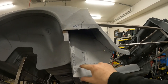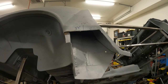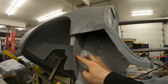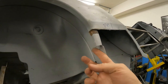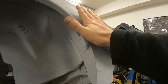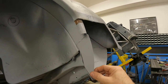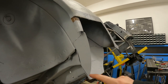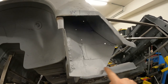We put in new pieces, kind of like a puzzle. We did this piece, and then a strip that went here that we bent, and added this piece here. We did templates for everything, and I went ahead and put this back piece in as well. I'm eventually going to put a lip that matches the inner skin here, but I'm not going to put this lip on until I test fit my quarter panel, so I'm leaving a little extra piece. We've mirrored the radius, but if we need to trim any, we've got hopefully excess to trim. Same goes for where we're going to have our seam weld on the bottom — we put some extra material there to trim.